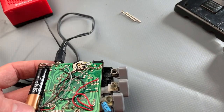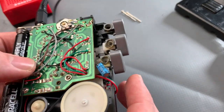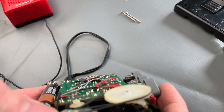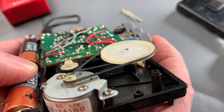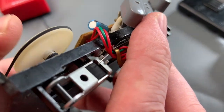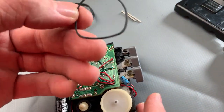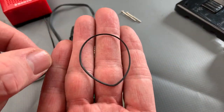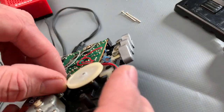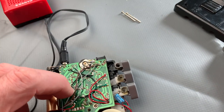Interestingly, you can also see the belt going around now. The belt's turning, so we know the motor's not seized — we could hear that anyway. Press play again and you'll see the motor — and that is turning. But interestingly enough, the slightest touch and it's off. Typical sort of teardrop shape where it's deformed from being in position. And that belt down here is not doing anything at all.